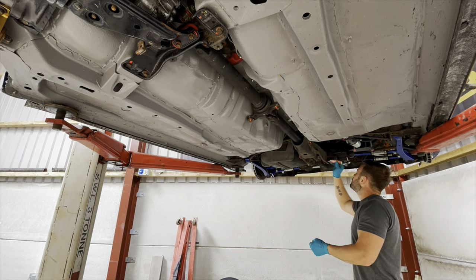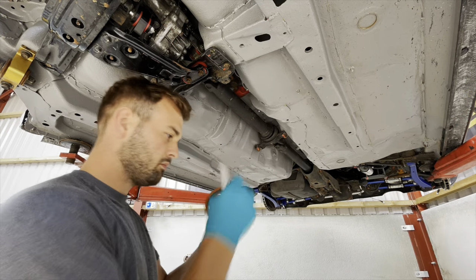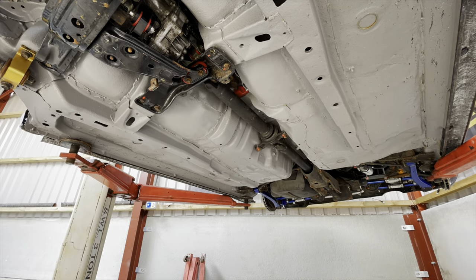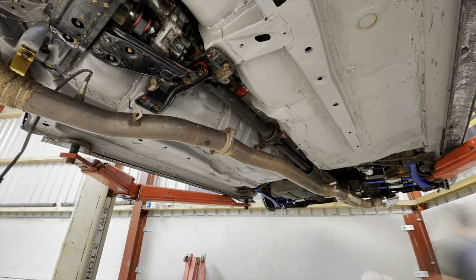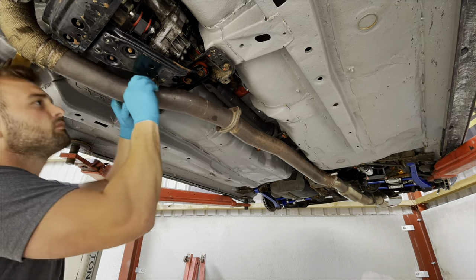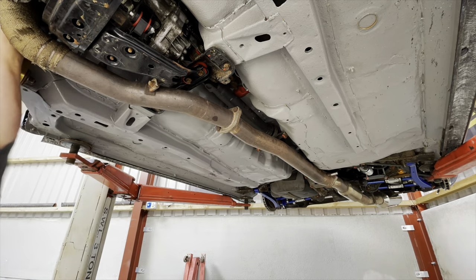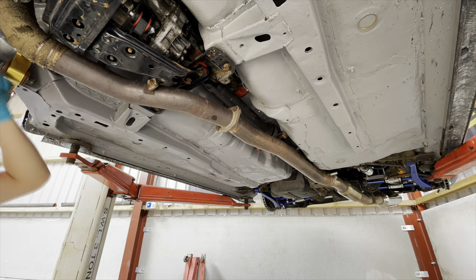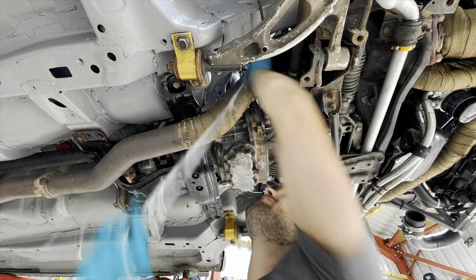I'm just re-going over all the bolts I've done with the torque seal paint. Next up is the exhaust system — it's got to be the easiest exhaust system in the world to put on this car. The only thing to watch out for is the lambda I've got in there for my gauge. I put a little bit of that 5990 copper-based gasket seal silicon — it's from Loctite, you can get it from Halfords — on the conical gasket that goes on the bottom of the turbo.